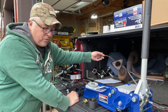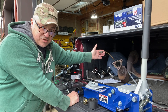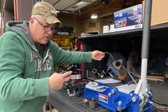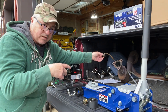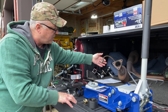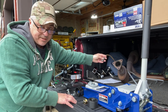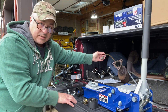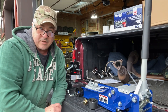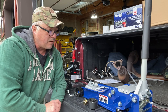Definitely want to be careful when you pull this unit out, because the connector on the passenger side front for the O2 sensor is routed up around another harness and I want to say a brake line or something — I'll have to double check. When you lower this pipe, it's going to get snagged, so be careful you don't snag it too hard and screw it up. Get the liner out first and then do what you've got to do.